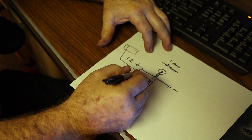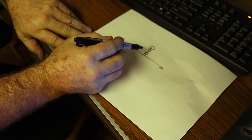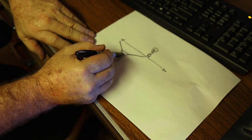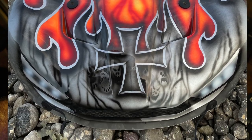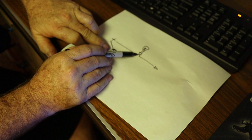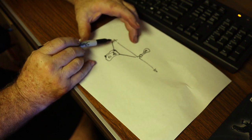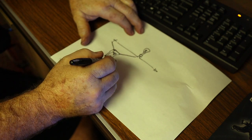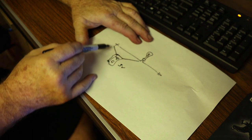To do a voltage drop test, hook your meter right at the bulb and then at the power source. If you run your meter from the bulb's power to the power supply circuit — whether at the battery or using a wire spool — you're on the positive as close to battery as you can get, and on the positive at the bulb. Say your meter reads three volts — that's your voltage drop. If the circuit has a poor connection, voltage will pass through the meter trying to get there because it's got 12 volts pushing on it.